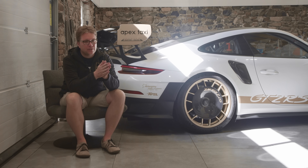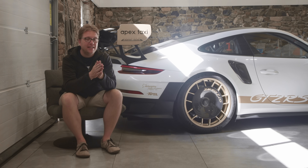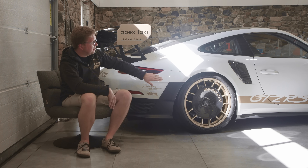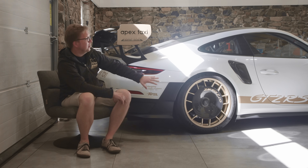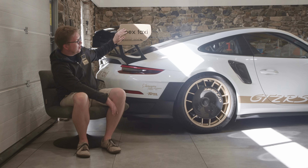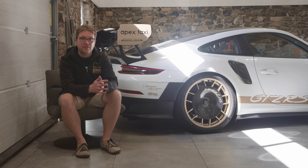So when I come out of a turn with two degrees of increased angle, I might only go from 80 kilometers an hour up to 200 before I hit the next braking zone. If I take out the two degrees of wing angle and put the wheel discs on, maybe I can get three or four kilometers an hour more on that straightaway because I was able to accelerate faster. That's what these wheel discs do — they allow us to run less wing angle, which means less drag on the back of the car and ultimately a higher top speed in every single straight-line acceleration point.